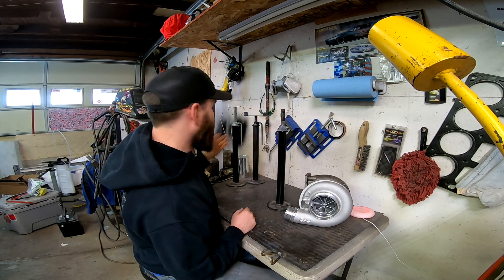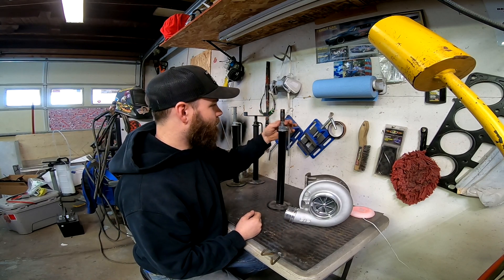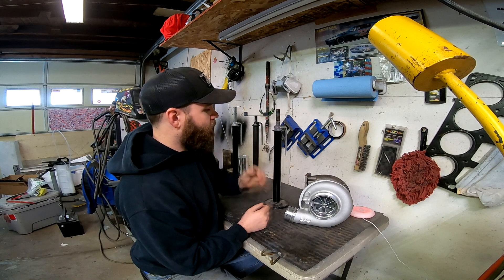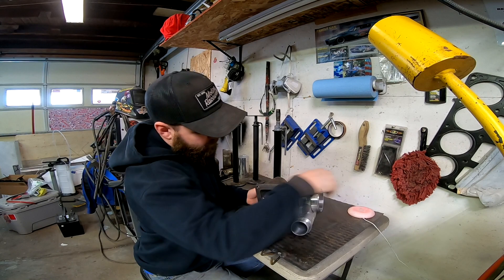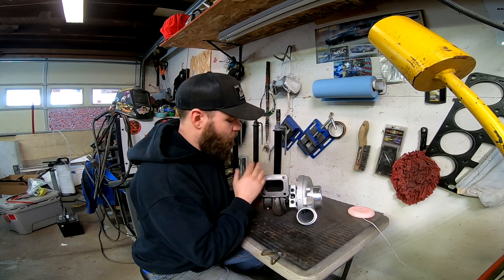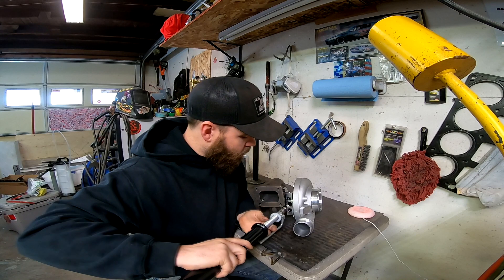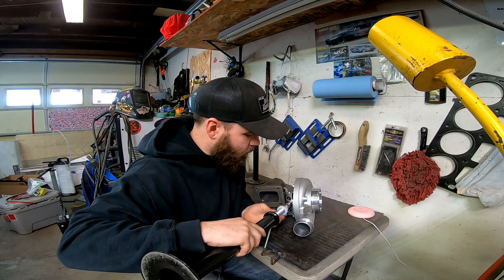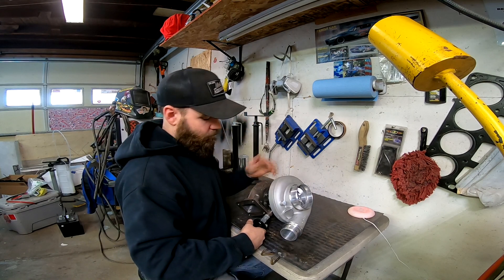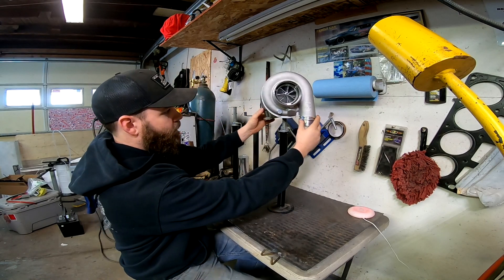I would actually make another one today, but my welder is still broken, so I'm not going to be able to make one — but I will show you how I do it. I just take the pipe, try to center it up the best I can, and then weld that on. Then I can take my turbo — and this is a Maven mount, if you can see it. This is what I use to mount all my turbos, which works really well; never have any issue with it. I take this end and just thread it right into the hole for the Maven mount — that's usually where your drain's going to be, like a 10 or 12 AN or pipe thread, whatever you use. Then you just thread it in there and stand it up. Super simple and easy. Now it's standing up by itself and you don't have anything in your way.